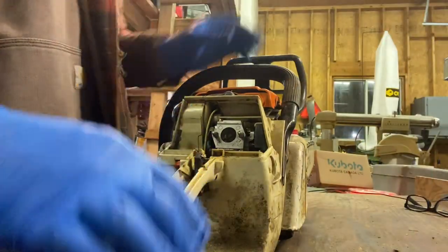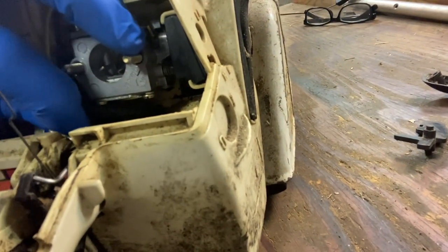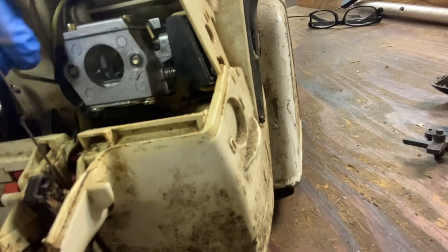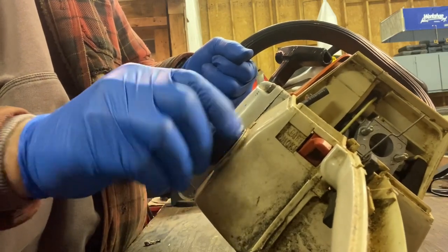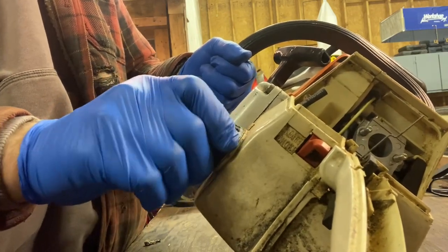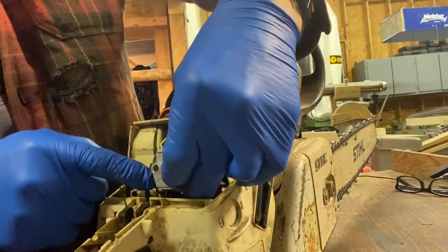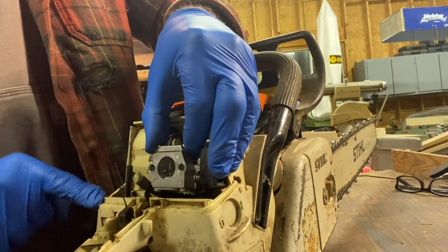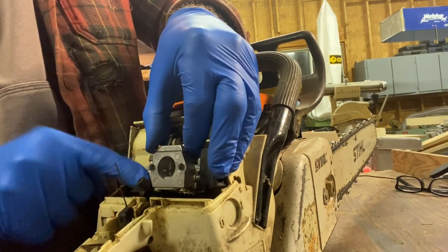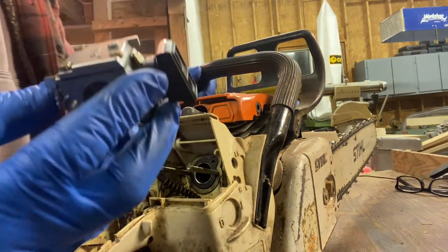Keep the handle. You want to get this linkage, tip it out like this and it'll pop out of place, then out of the carburetor. One thing you want to do is open your fuel tank, let the pressure out, close it again, and then pull your carb up. Then pull the fuel line off. If there's pressure in here and you pull that off it'll just shoot fuel out at you. There is the old carb.